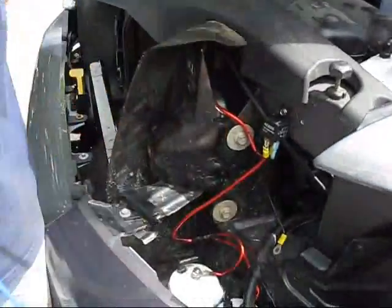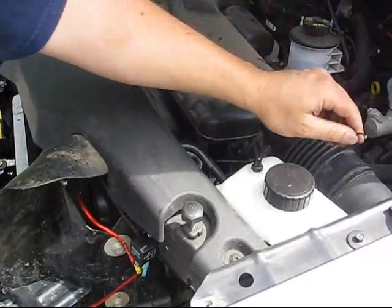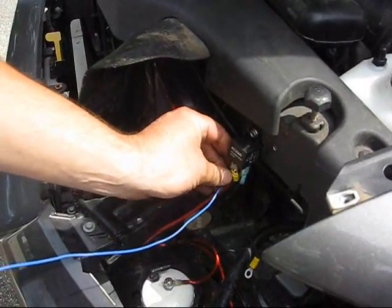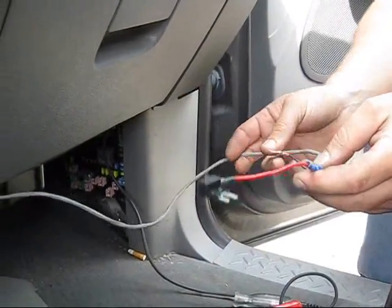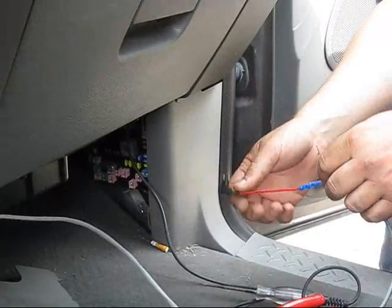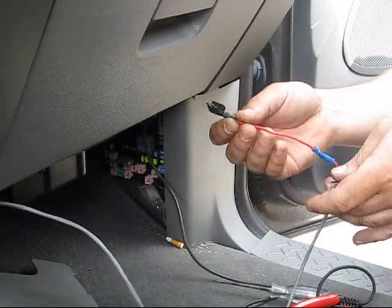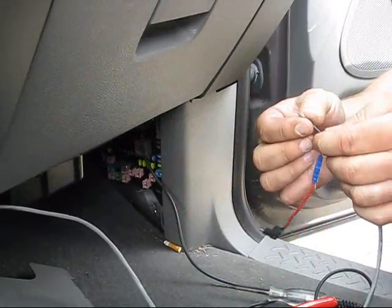The black wire will attach to one of the black wires on the float sensor on the tank, and the blue wire will go on the outer terminal that's not used yet on the relay. The inner terminal does not get used for anything. The other set of wires coming off the switch box in the gray sheath run over to your fuse box. Find a fuse that's only on when the key is turned on, pull it out, plug this added circuit in, and then put your fuses right back in. The other wire just goes to a good ground source under the dash anywhere.